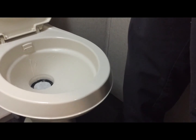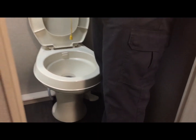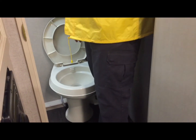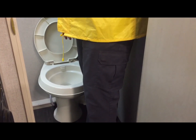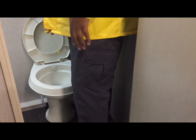This is also where you're going to apply the black tank treatment chemicals. After each and every time you dump, before you use your toilet, you will have to apply a treatment chemical simply because it can break down your waste, so it'll go through your drain out there. Also to keep the smell from coming inside when you're storing.